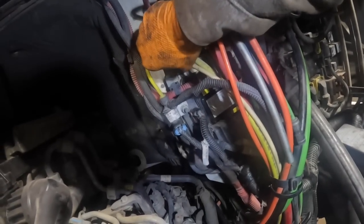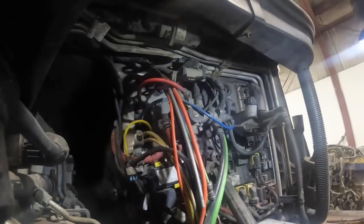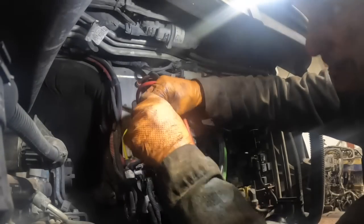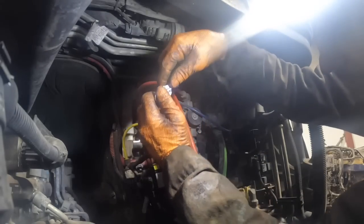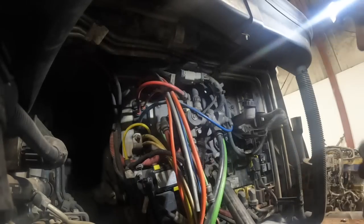I'll just put this nut on there because it was on there, I guess. Everything there is kind of plugged in. Now I just basically get this hydraulic slave cylinder plumbed up in here, and then we'll have to bleed it once we get it in there. Clips in it. Yeah, okay, we're cooking right along now. As my dad used to tell me when I was a kid, boy, we're cooking with natural gas now.